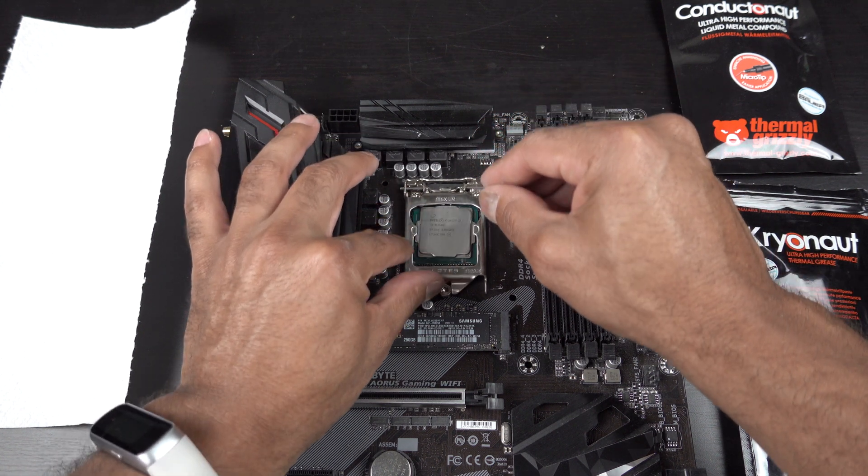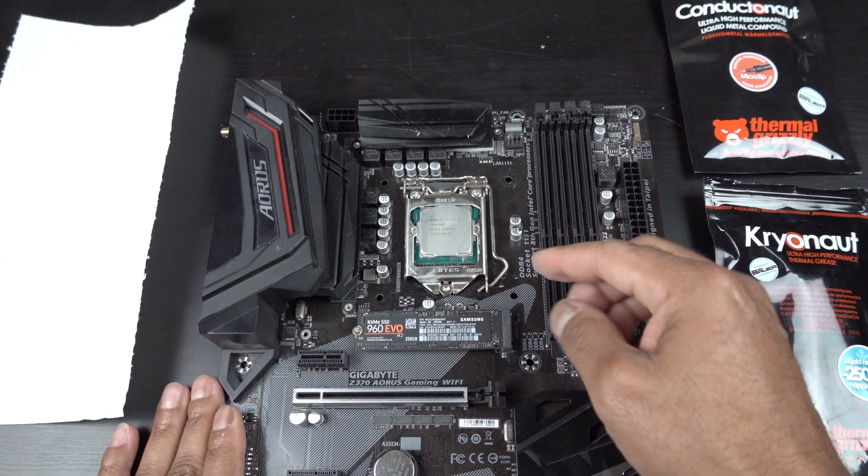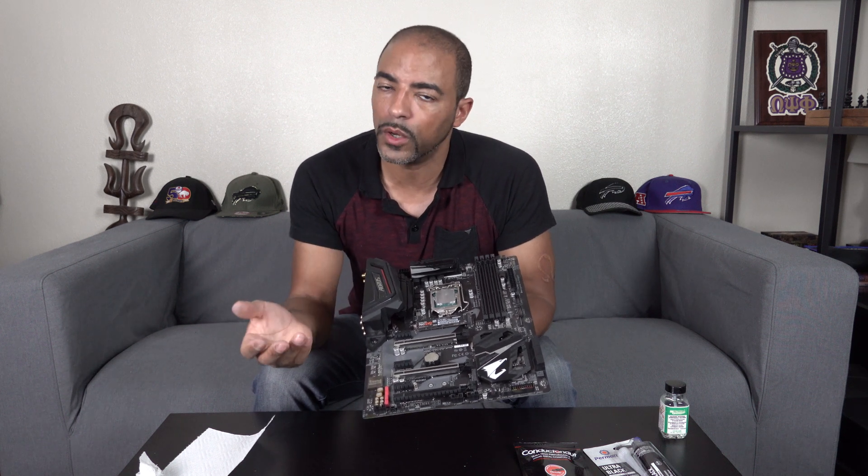I like the way this looks — just enough liquid metal to ensure contact. I'm going to put that back. If it was drier on the IHS, I would apply a little bit more, but this has been good. So that's really what liquid metal maintenance is all about — taking off the IHS once every six months or a year to make sure it's in the right position. You don't want it spilling anywhere; if it was, you used too much. Liquid metal has really strong surface tension properties, so if you apply just enough to slightly coat the IHS underside and the die, there's not going to be enough to go anywhere, no matter how much you jar your PC.